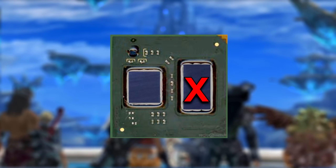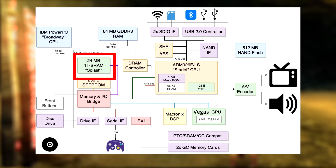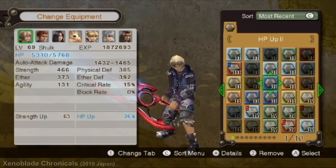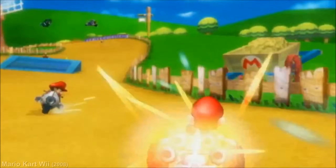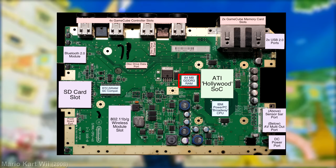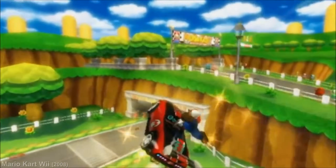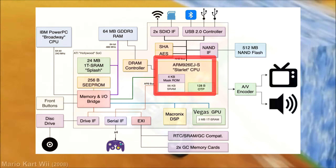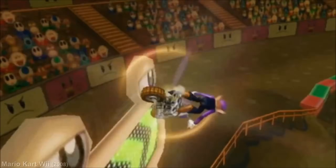Then there is the NAPA, the second die, which holds 24 megabytes of 1T-SRAM — a fast memory pool shared between the GPU and the CPU. A note worth mentioning: later Wii revisions, codenamed Bollywood, combine these into a single chip to save power and space. This 24 megabytes of 1T-SRAM was further backed up by an additional 64 megabytes of GDDR3 RAM built into the motherboard. Of this, up to 22 megabytes was reserved for the operating system and the ARM CPU core that also processed the OS, but we'll discuss that in a future video.